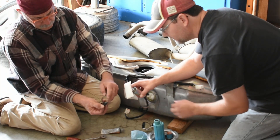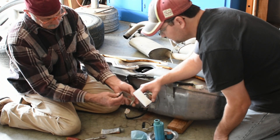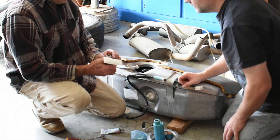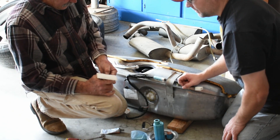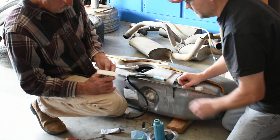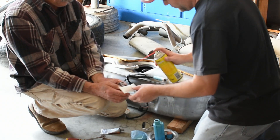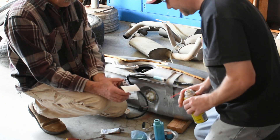You've got another one right here that fits on this piece. It's got two tabs here, two holes — line it right up like that. We put the rubber bushings on the pump itself before we try to get it on the retainer. We may have to wind up hitting it with a little bit of silicone lubricant to help slide it all back together, because it is a pretty tight fit. I'm going to use a little silicone lubricant — it's a wet type, it does not dry or glue it. It just simply helps things slide back together easier.